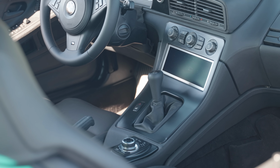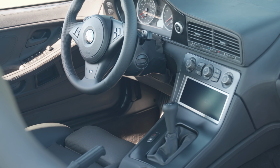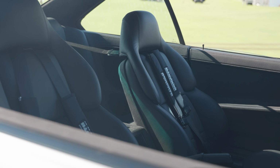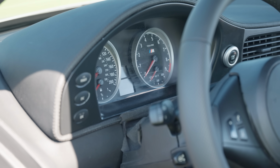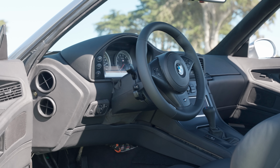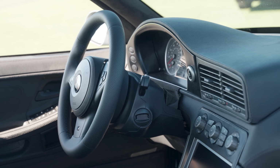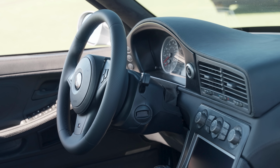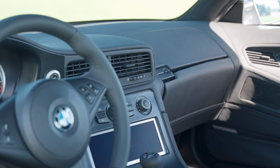So a big point of how I like my cars built is I like to have that period interior because I like the car. It's a great design. So we maintained all the interior elements of an 8 Series, and we integrated the E60 componentry into it that we needed to, like the gauge cluster, the power DSC EDC button. You know, we changed the entire drivetrain, so the E60 rack and steering column is in with all those attributes, and it just fits in. You know, it's all BMW styling.